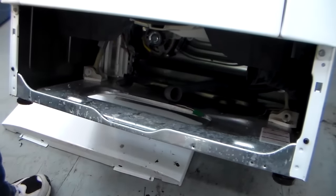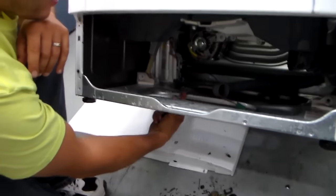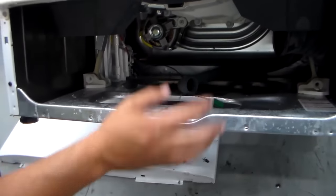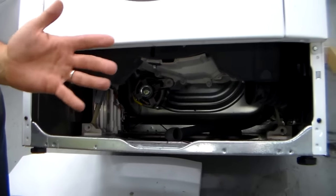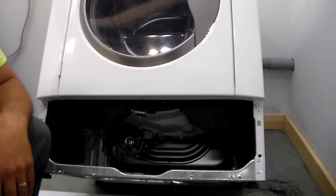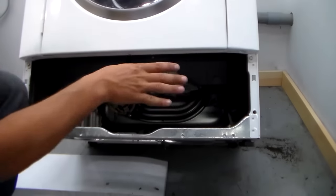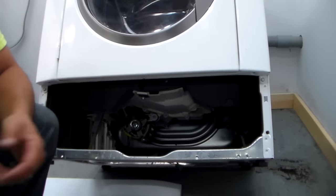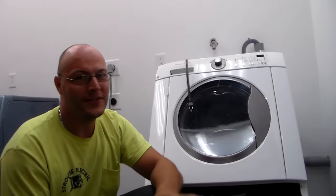Now if you have a machine that does not have a removable front panel, you basically have two options. You either work through this hole, which is a huge pain when you've never done it before, or the other option is the longer way — actually removing the whole front panel so you can get to it easily. I've found over the years that instead of trying to reach up through the hole, I take the whole front panel off just to do what I did to this pump, because it's so much easier. It might be more steps but it saves time and frustration in the long run, and you can make sure the hose connections aren't going to leak when you put it back together.